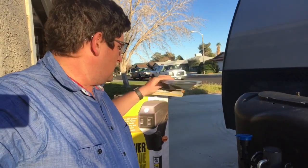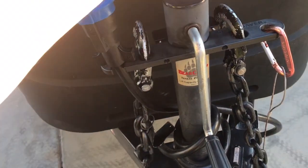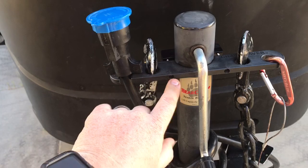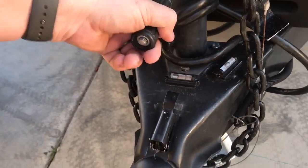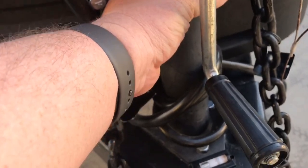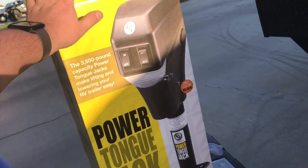I'll show the process for this - we also got a little cover to protect it. I have what's called a chain saver attached to the top of mine right here. The first thing I have to do is use a Phillips screwdriver to undo these and drop this down. I also need to make sure my jacks are already set for the trailer so I can raise this jack all the way up, then loosen the bolts to remove the entire jack. From there I can start unboxing the new jack assembly.